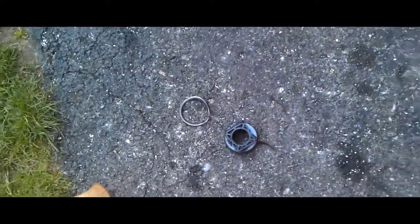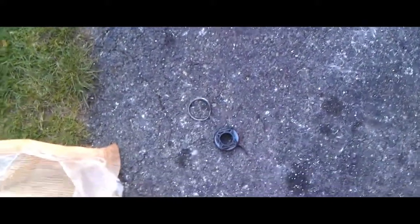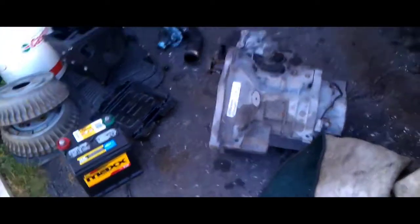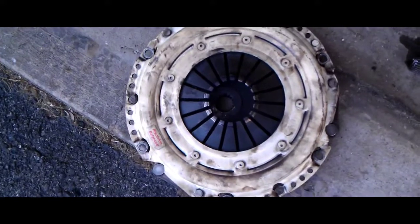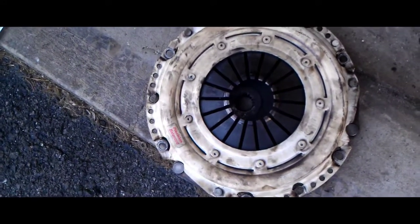When the car was completely stopped it went into every gear, but when you start the car up it didn't want to go into any gear at all, so we assumed it was the clutch. Just to give you guys a heads up, we did have a Clutchmaster Stage 3 clutch in here. As you can see, that throwout bearing did some damage. So we are actually going to go with an OEM clutch, as we have right here in the transmission.